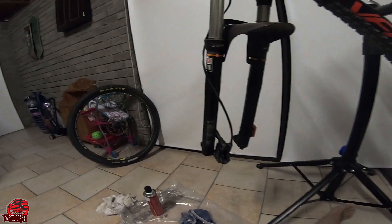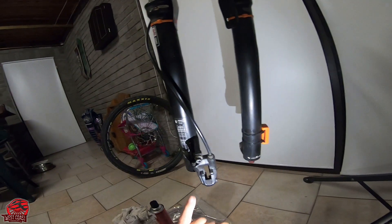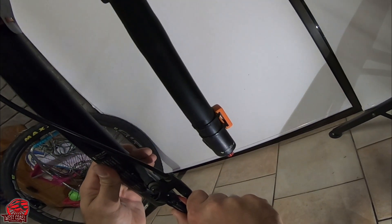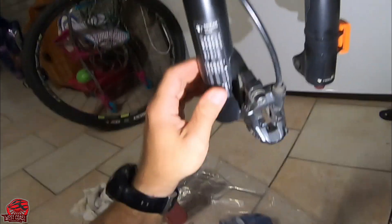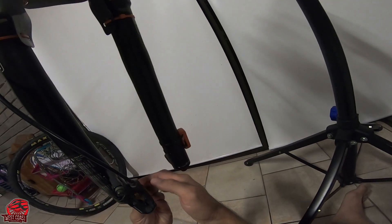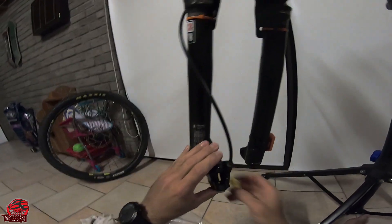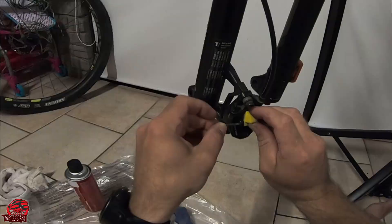Let's see if we can turn some light on the subject. If you can see there, we've got these pistons — we need to push them back into place. The pistons are back into place. Now I'm going to try and put in this block, which I've noticed already doesn't fit. So my problem is this block doesn't fit inside the caliper. For this exercise I'm going to just put it in there and then use the split pin to keep it in place.